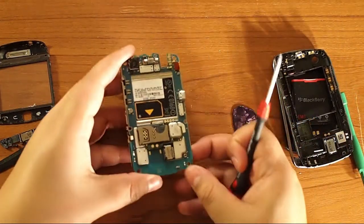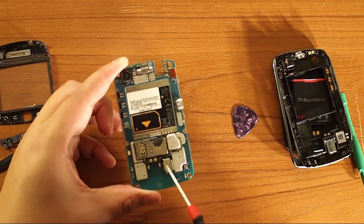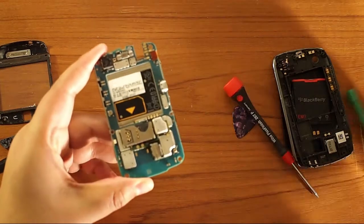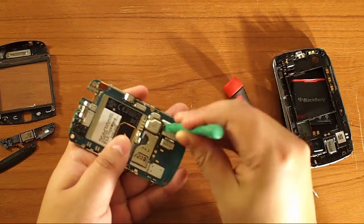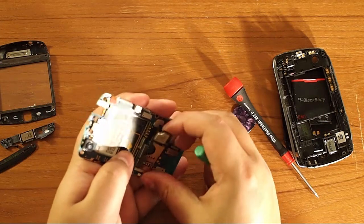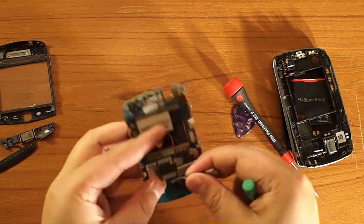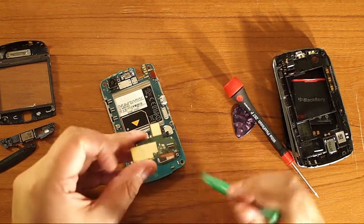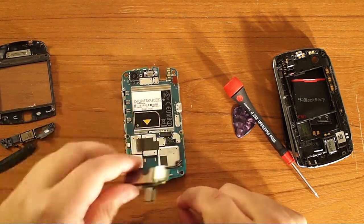Here I'm going to go over a couple things. This is the SIM card slot — someone recently asked about replacing that — and that's the memory card slot. This whole assembly can be replaced very easily. Take the opener tool; it's two-way taped on, so try not to break it. If you're replacing it anyway it's not a big deal. Lift it up carefully — don't yank it off. You can see the connector here and the connector here. You can order this piece separately and replace your SIM card slot or memory card slot. Very easy procedure, no soldering, nothing crazy.